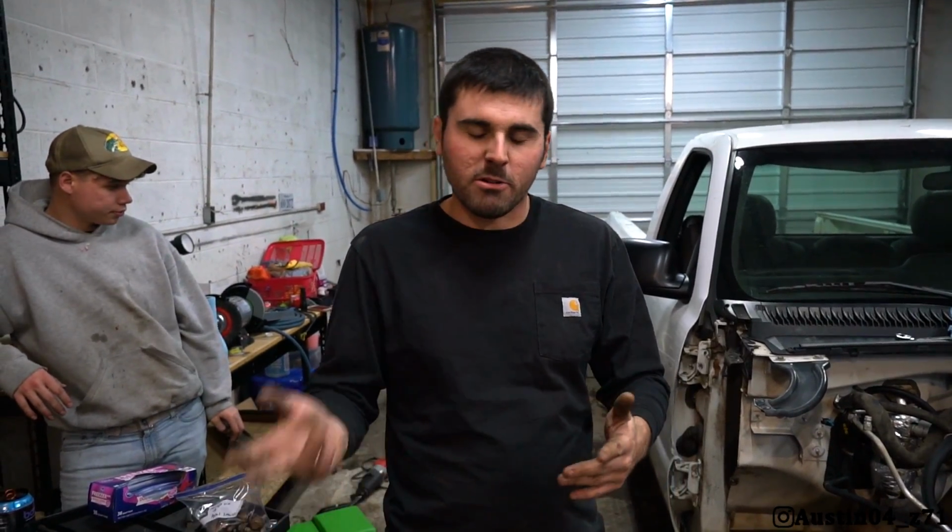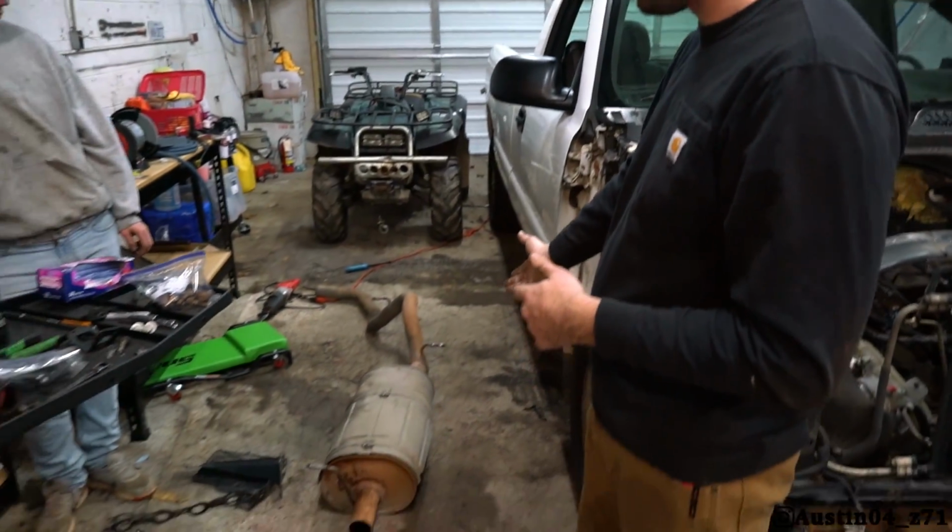Same thing applies to turbos. With a smaller back housing, you could build up too much back pressure depending on the engine size, so you go to a bigger back housing. Same science applies to the exhaust.